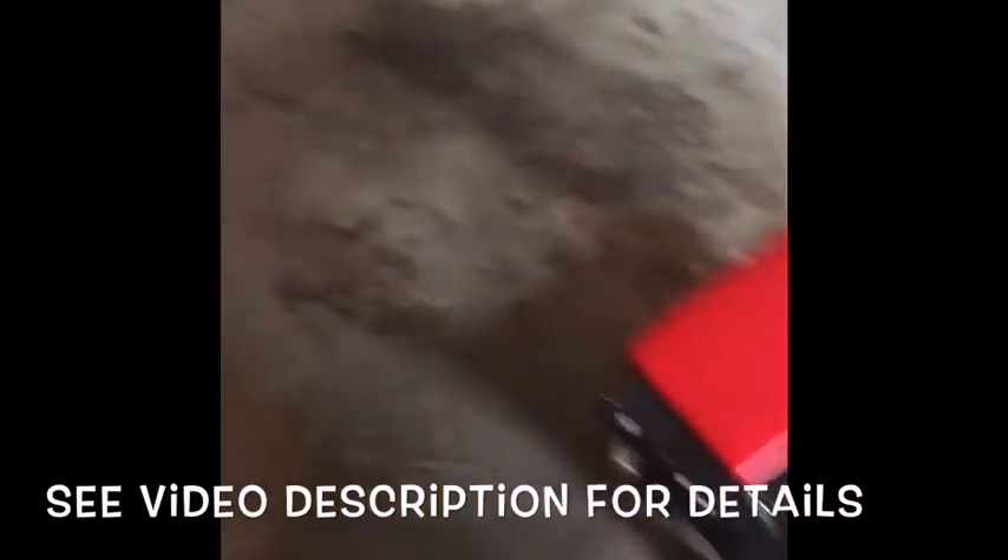Bringing it down to 20 milliamps, which is acceptable when the car is off. Thinking about that, my brother-in-law had installed something on it to allow you to play audio from an iPod, iPad, or iPhone through the aux input. He installed this device, which was hooked into the back of the radio. I went ahead and disconnected it from the radio, ran the test, and it dropped to 20 milliamps.